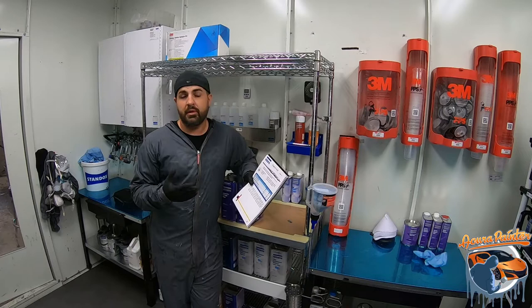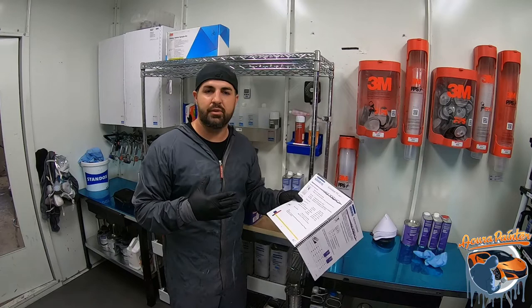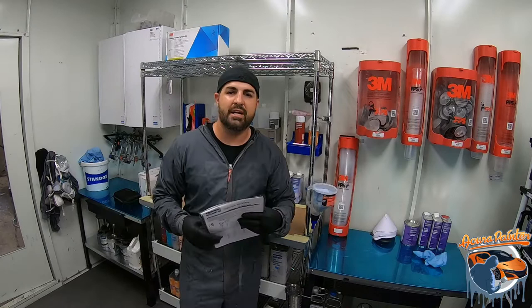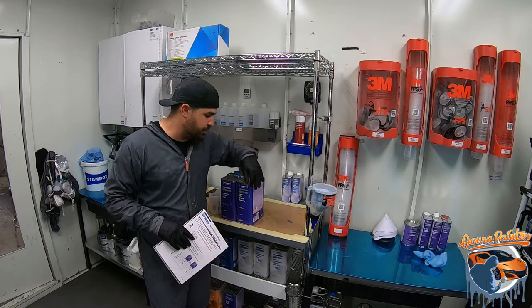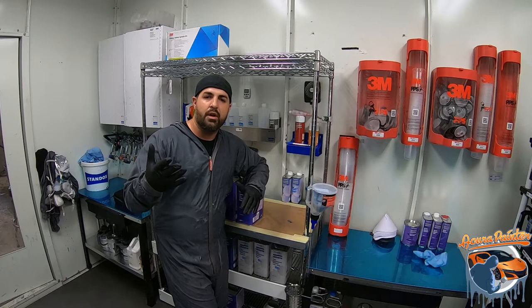So what this is gonna tell you right here is gonna tell you, for instance, how much flash time, how to spray it, what kind of tip to use, how to bake it, all that technical stuff that you're gonna wanna know to maximize your product. So what I did is I found this actual product here, HS 2-pack clear. We use it fast because it's a small panel. And from there, it's telling me I need to let this flash between about 6 to 10 minutes, okay? So once I let that flash, I can put on another coat.